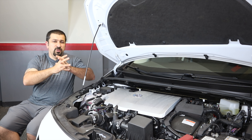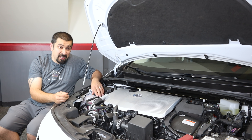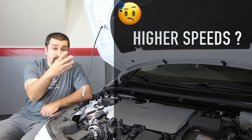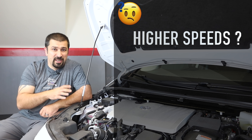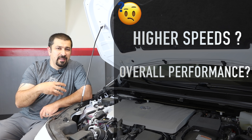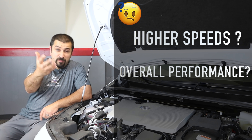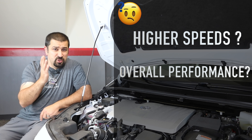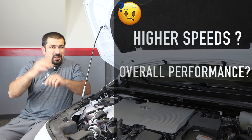Here are the problems they faced when taking a regular hybrid and turning it into a plug-in hybrid. Problem number one: how are you going to drive the car at higher speeds? These EVs are rated to 84 miles per hour — a far cry from 25 miles per hour in regular hybrids. Problem number two: how will it have enough power now that the engine won't be contributing? In a regular hybrid in EV mode, if you punch it even below 25 mph the engine comes on immediately because you're demanding more power.